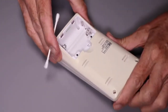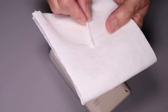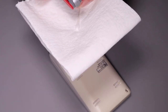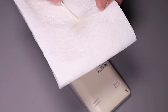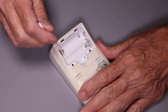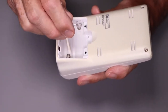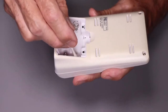The last step, which is one that a lot of people don't do, is using a little bit of WD-40. The best way to deal with that is to take a paper towel, put the cotton swab in the middle of the paper towel, then take your WD-40 and put a little on there — this way you don't have it spraying all over the place. Now go in and gently massage all of the contacts with a little bit of WD-40. We're not soaking this. Do all the contacts even though they didn't have any corrosion on them.